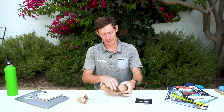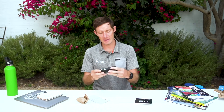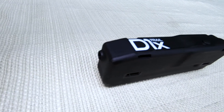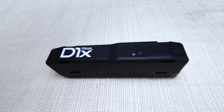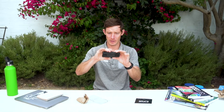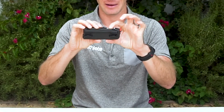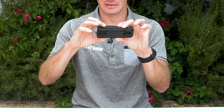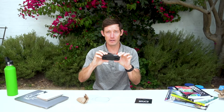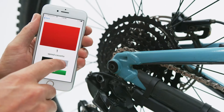Clearly a mountain biking company — it's even wrapped in brown paper. Conceptually, you're going to mount this pod on your rear chainstay. The only possible limiter is if your chainstay shape doesn't accommodate the box practically. Your rear derailleur sits here; the cable runs into the box and out to the derailleur. The pod has a battery and transmits the shifting signal wirelessly. It uses a smart shifting system that calculates the distance of each shift, so it does a lot of the legwork for you.